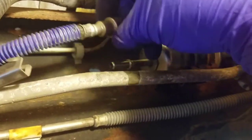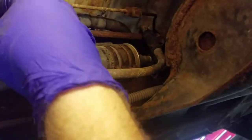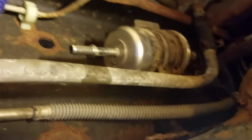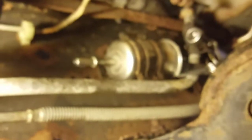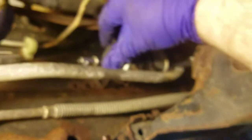This is going to spill out some gas, so try to hold that hose up a little bit and bend it like that. Make sure you're wearing eye protection because gas will spew out — not a whole lot. The top one towards the front of the truck is a little harder to get out, but you basically have to have one hand on the hose and one hand on the clamp.